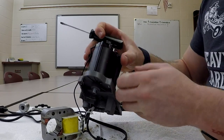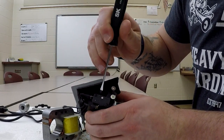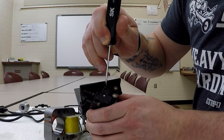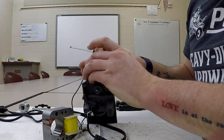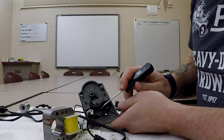If you listen to this switch on the front, which is what actuates it when the pencil goes through, hear that positive click? That's what it should sound like, and it doesn't sound like that. The other pencil sharpener that I ripped apart had the same problem, so I actually think this switch is the weak point in here. All right.